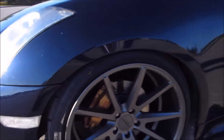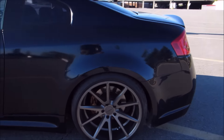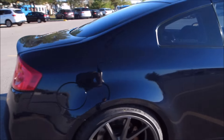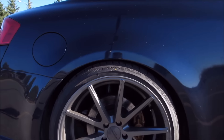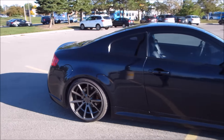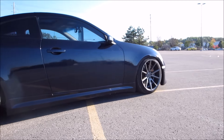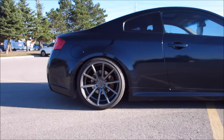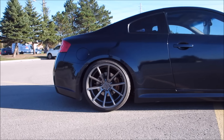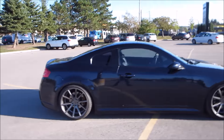Height-wise, the fronts can go lower than this but this is just where they're at right now. The bigger problem is the backs — this is as low as the backs go, so I need them to come down a bit more. There are two collars I'm going to have to remove to get it lower, but that's basically maxed out. The Teins don't let you go as low in the back as in the front, but there's a lot more room behind the wheel, so I'm not having any contact issues with the wheel hitting the strut.